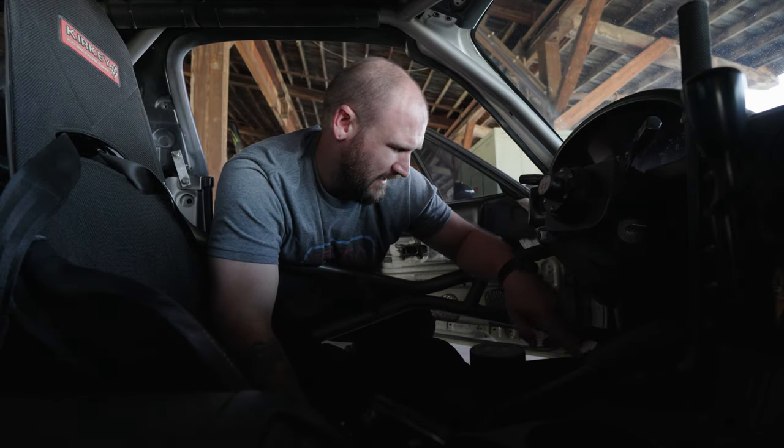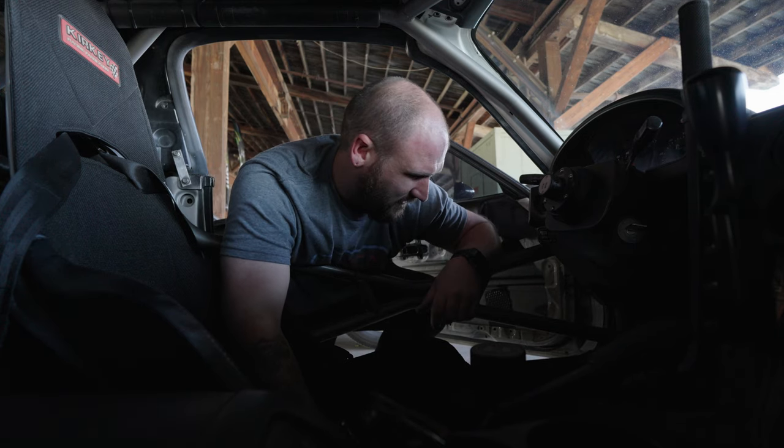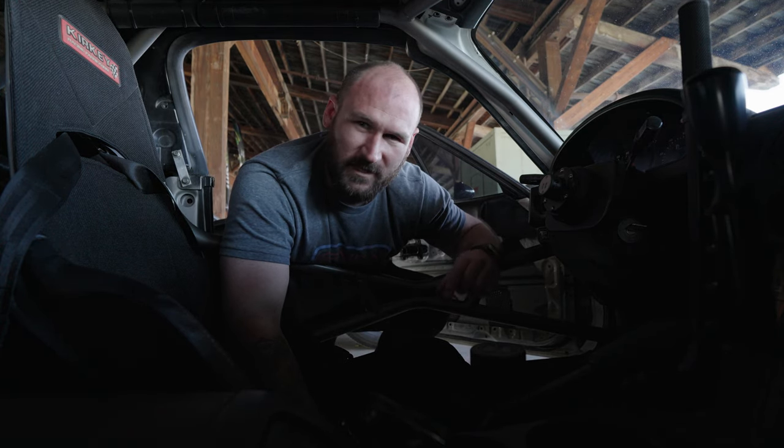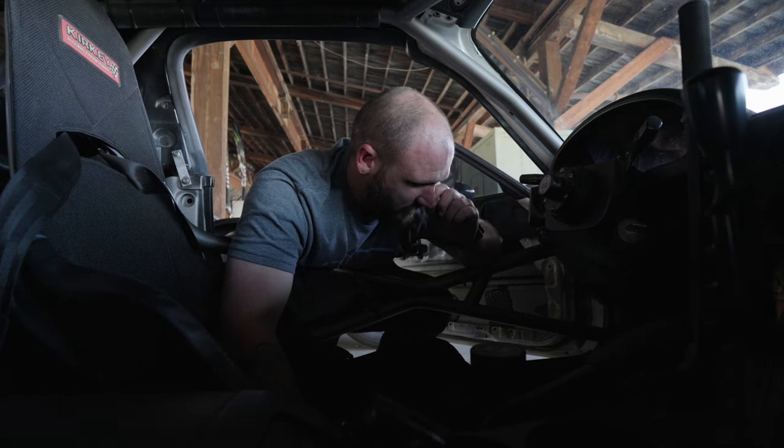On those first few laps I actually noticed that my clutch pedal has no free play in it once it gets hot. I need to adjust the rod that goes up to the master cylinder just to give it a little bit of slack. That way it's not kind of pushing the pedal without me pushing the pedal. I'm going to loosen that and get a little bit more free play between the point at which the pedal engages the master cylinder, and then I'll feel a lot better about not burning up the clutch today.